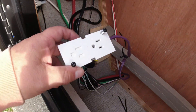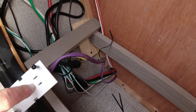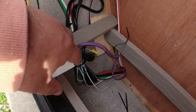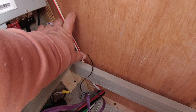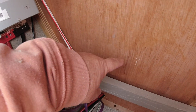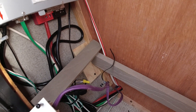In this compartment there's a plug — the hot plug that goes to the inverter and runs from shore power. My plan is to cut this off, make it a double plug, and mount it outside the battery box area so I have two plugs: one for the inverter and one for charging the battery. I'll disconnect this for now and leave it outside until I can get a new plug.